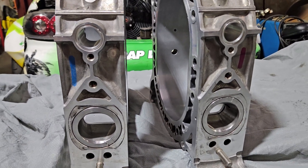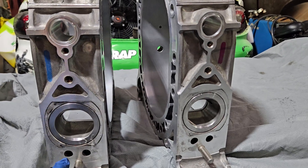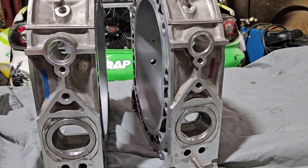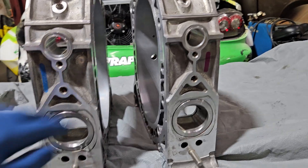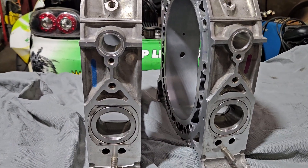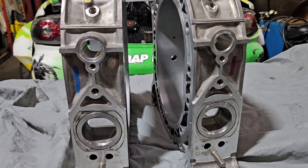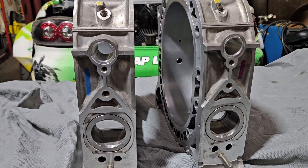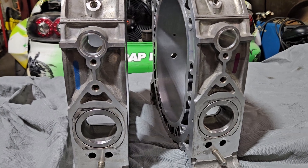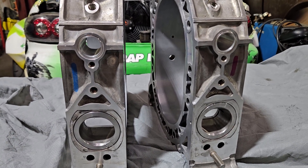I thought this was a great example — beautiful port work. We've got a really nice semi-peripheral here. We put in the little O-ring spots, and they're DEVCON filled, which is classic. That's what Mazda Racing and most of the IMSA guys have done for years, and same thing with drag racers. If anybody needs this kind of stuff or has questions, feel free to reach out to KMR. This thing's definitely going to brap hard.